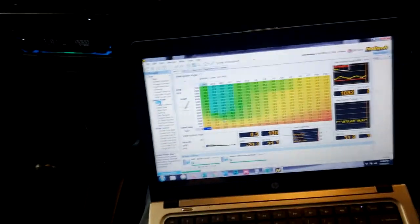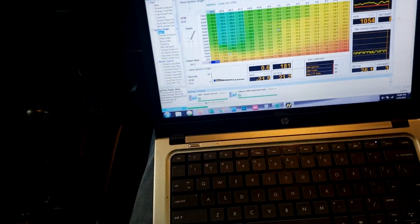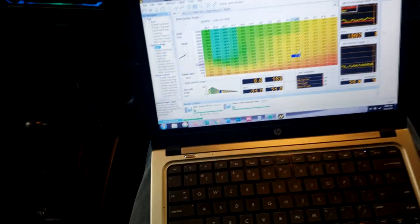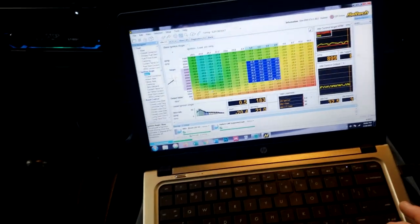Have you made any changes? No. Do you want to see the picture of the ignition map from the base? That was the ignition map before. It doesn't have to be exactly that, I just feel like maybe I need more in some areas, like from 2500 to 3500 RPM — probably like negative 10 to 0 back in that range. So pretty much this whole area. I just kind of took this whole section and went up a few degrees.